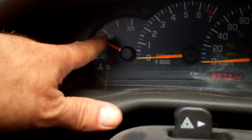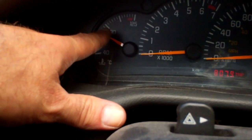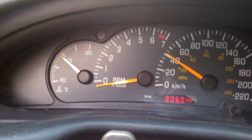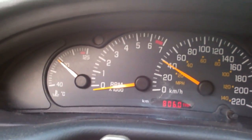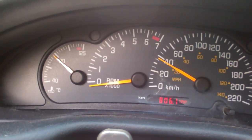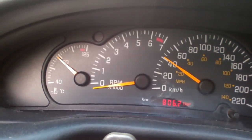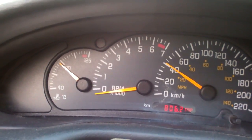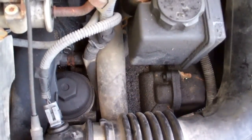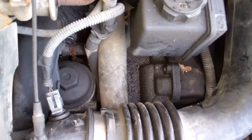Keep a close eye on that gauge. It should go up around half, and then our thermostat should open up and let the engine cool down. The temperature gauge is over on the far left — I've only been driving a short time and it's already up to around half. The low coolant level might have been a symptom of the problem and not the actual cause. Be very careful working around an engine that is running. If you're nervous about it, don't do it — shut the engine down and do the checks that way.